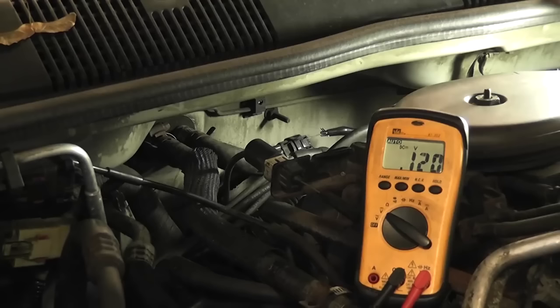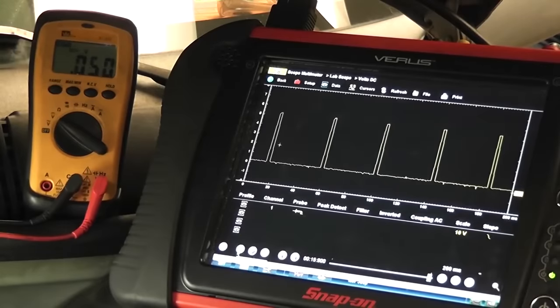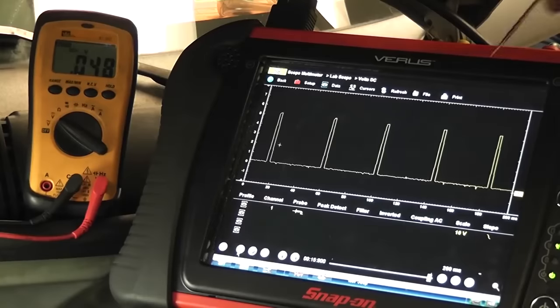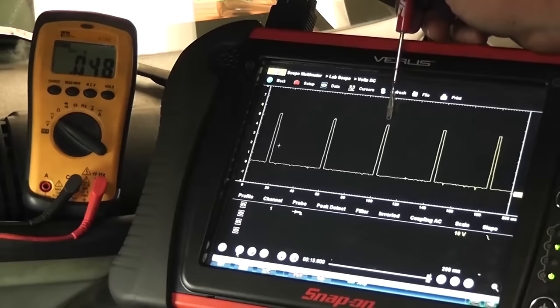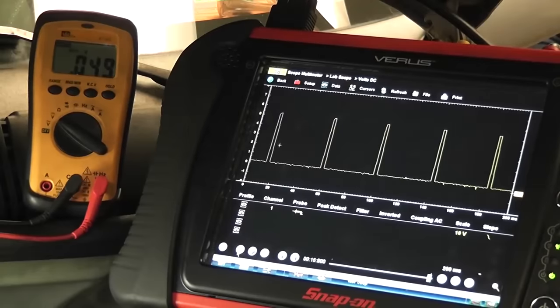I'm going to show you what it looks like on the scope now, which is absolutely the best way to do it. We had 500 millivolt average cranking on the voltmeter, and you see our square waves — those are zero to five volt square waves. You can understand the design now: the reason the average is so low with a zero to five volt square wave is look how much longer that signal is low compared to how long it is high. If you were to average this — which is what your voltmeter does — your average is not going to be two and a half volts, because the high portion is so much smaller than the low portion. Your average is going to be very near ground voltage, and that's what we're looking at. That's your crank sensor signal — cranking, this is a hall effect on a scope. Obviously, the scope is the way to go.